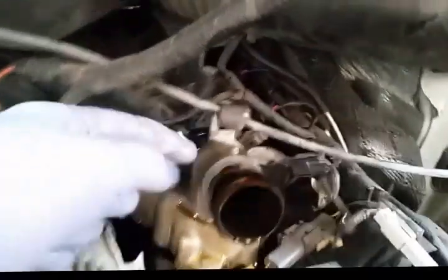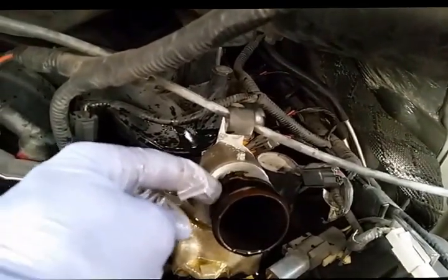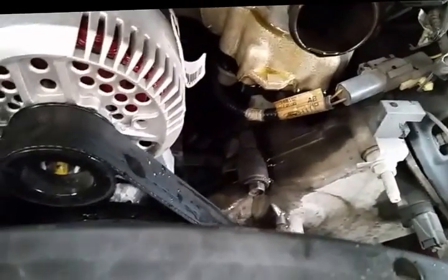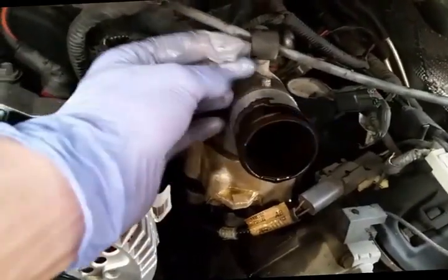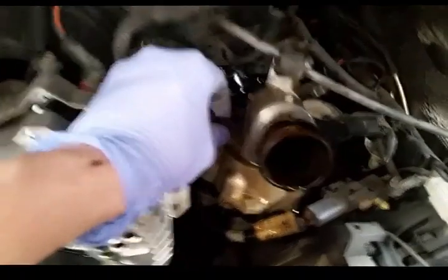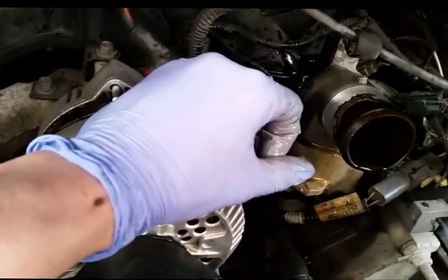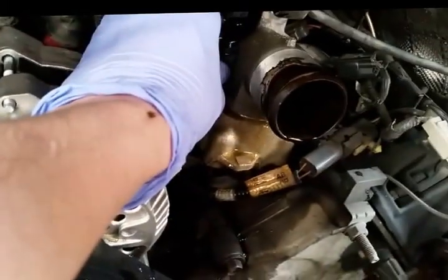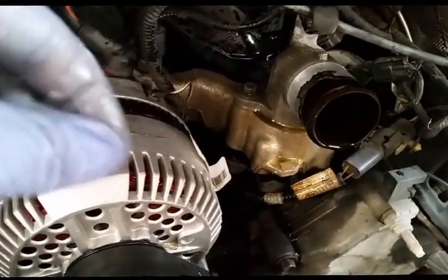Now here's what we've got to work with. Here's where the hose fits over. We'll have to verify that the clamp is on really good the second time — it's lipped here so the clamp needs to go past that lip. That's very important; you don't want leaks here. I've got to go for these two bolts here, one on each side, and we'll pull off this headpiece — looks like we also got one up here. We pull off this headpiece and the thermostat should be right there. This is the last stop before the coolant gets to the engine — the thermostat opens and closes depending on the temperature, letting more coolant in to cool the engine or less coolant to warm the engine. So this is a very important piece, and the repair is not so bad.